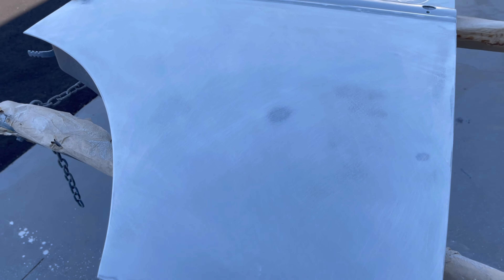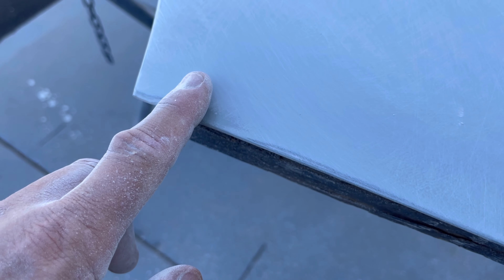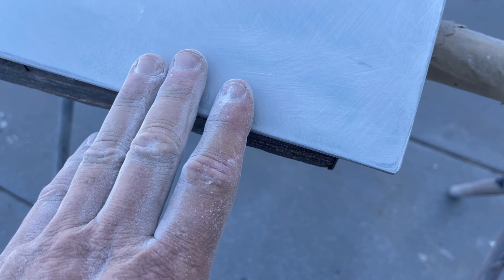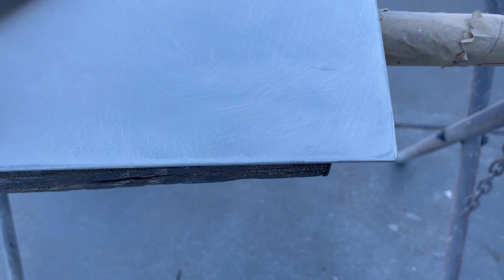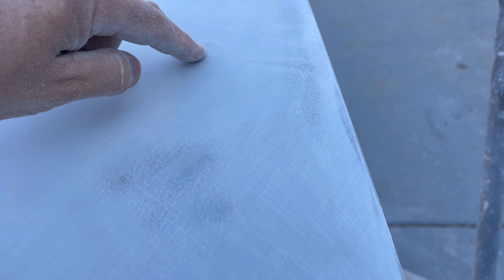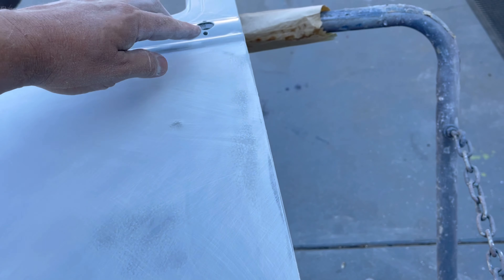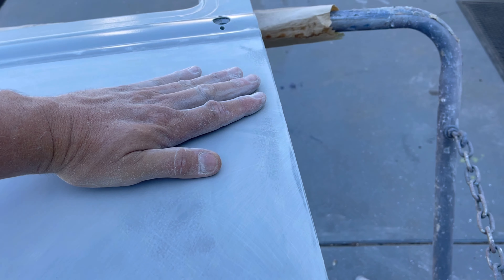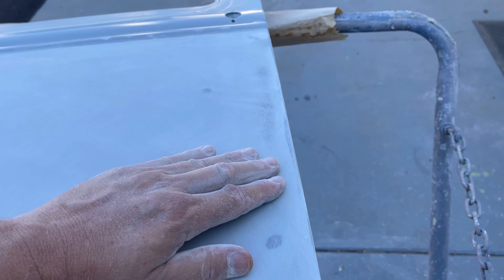So this is about 10 minutes worth of sanding with the 150. Right down here — touch metal, touch metal. A little low spot — scuff that up, put a little glaze on that right across there, make that go away. This is stuff you would not see if you were not blocking by hand. Up here I start to hit the primer — don't go any further, walk away. But right here is just a little bit low. Here's that area right there. Now I could go in here and dig this out, but that's not what you want to do because I hit metal here and here — I have metal, metal, metal.